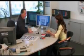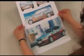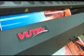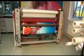The following movie clip shows tips and information for complete car wrapping with ORAJET 3951 and the matching protective laminate ORAGUARD 290. The graphic design agreed with the customer is printed on a suitable digital printing machine and then, after the required print drying time, laminated with the protective film.